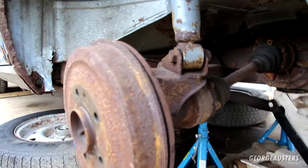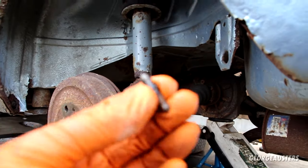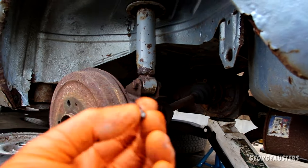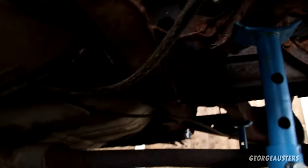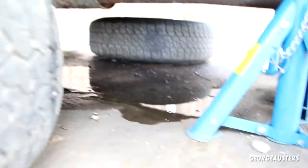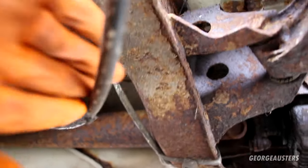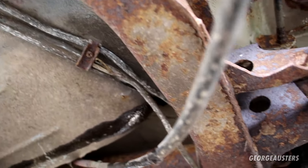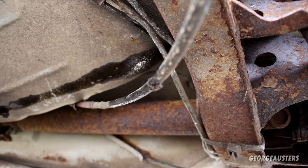Big problem. It began to bleed and then it stopped. I tried removing the bleed screw fully — maybe it's just blocked — but fluid still wasn't coming out. But it is coming out of one of those brake pipes up there. Massive puddle all over the floor. I think it's just rusted through, to be honest. It's definitely one of the rears — I think maybe the other side.